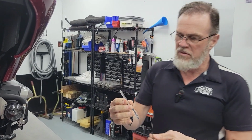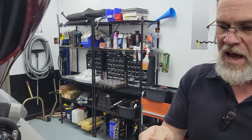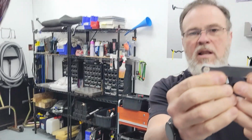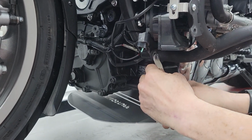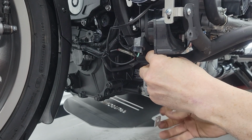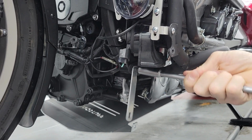Okay, so I just carried this away and I went to, we have a belt sander, and I just put this on the top edge of the drum. You may not have that. A rat tail file in five minutes will do the same thing, but I'm taking that notch down in it. That's going to let me fit this bracket around this weld on the engine guard. Okay. And then in theory, it will line up with the pan, which it does. So let me put this hardware in and we'll see what this all looks like assembled.